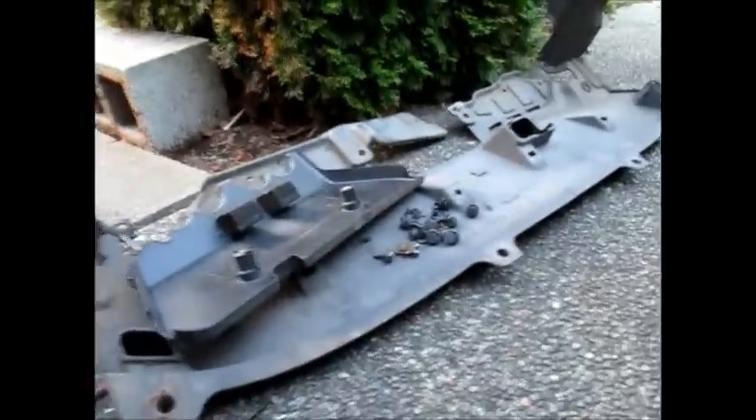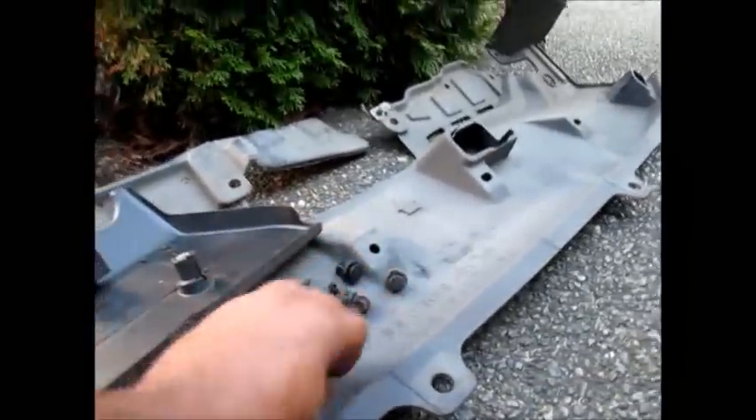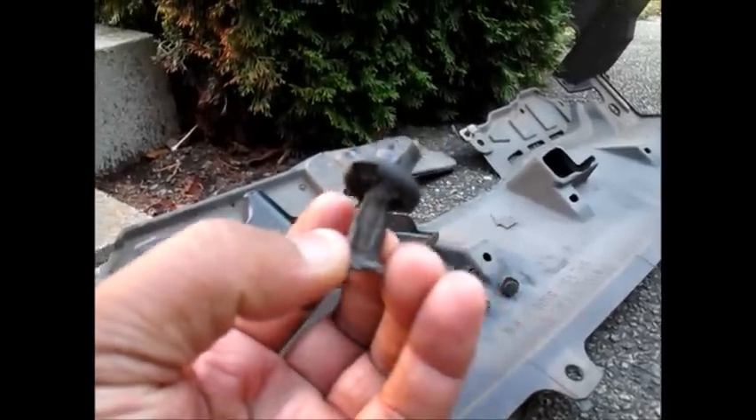To start doing this, what you need to do is take the undercarriage off. The undercarriage is right here. It uses little plastic bolts — these little snap pins where you just pull it out and the thing will come out. They have some right up here on the wheel well, and if you go underneath they go here and all the way across there. You'll have some down here and some go in the middle. There's a 10mm bolt that goes here and another one that goes here.